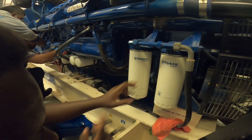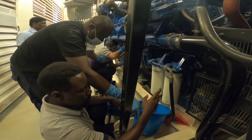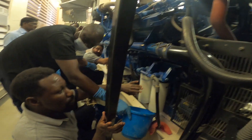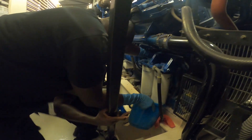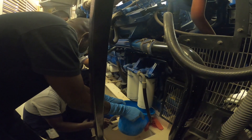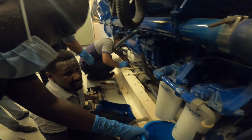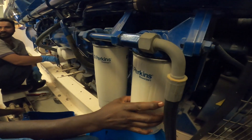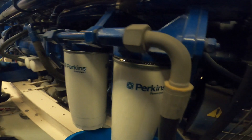You don't tighten fully — we don't tighten fully because we need to remove the air bubbles. So we'll open the fuel line so that the fuel can flow. We need to make sure there's no air bubbles — we need to release air before. You can see the bubbles coming out.